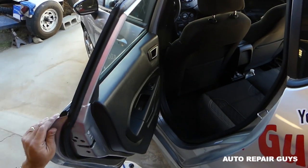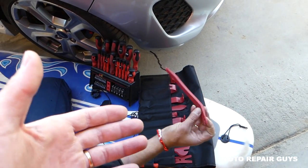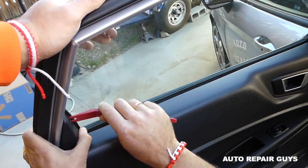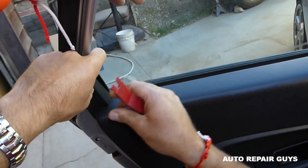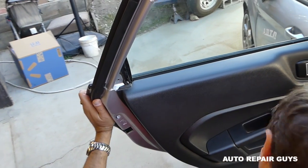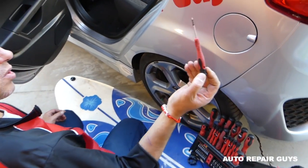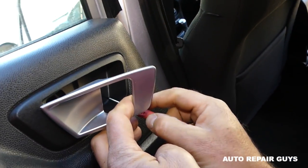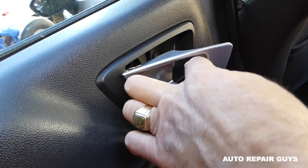Open the door and we'll need some door panel removal tools — two screwdrivers. We'll have the links in the description for the tools and parts we use. First, we need to pry that cap open. Be careful not to damage it — you can see where the clip is. Then grab a small flathead screwdriver to pop open one cap on the side.